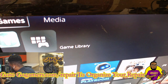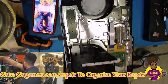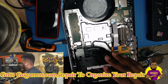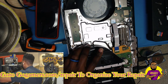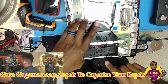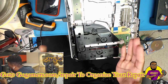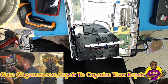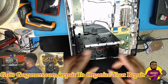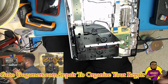I want to make sure you guys know too — when you have your Blu-ray drive outside the chassis, when it takes the disc, kind of pop it up and hold it at an angle. Make sure you avoid this gear right here. When you eject, hold it like this so it can properly flow the disc outside of the Blu-ray drive. Because if you don't hold it like that, those gears underneath are touching the top chassis of the motherboard and it's going to clip up, and it might not take in or eject very well. So that is a PS5 that was just successfully repaired.